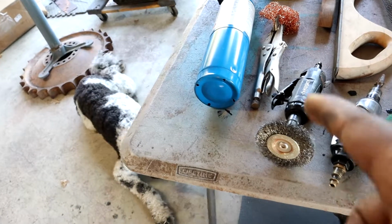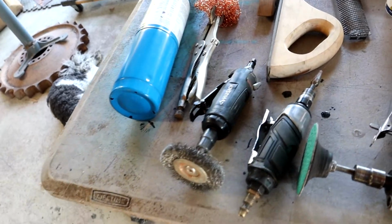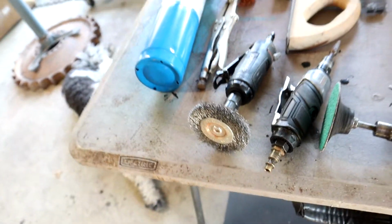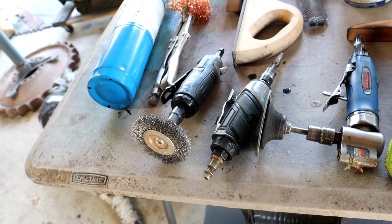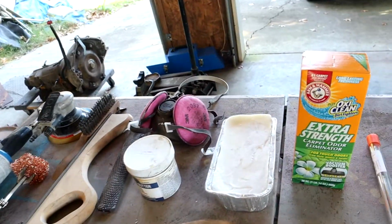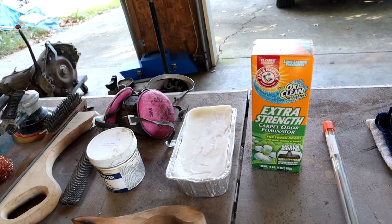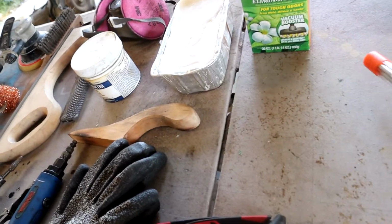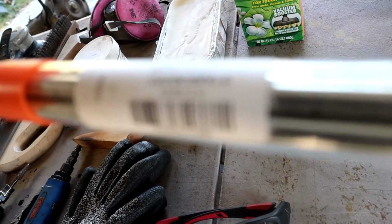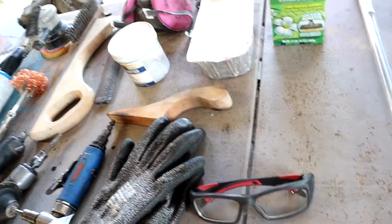These are some tools that you use to get it very slick and shiny, like a wire brush and a wire wheel to get into the edges and corners. You also have your 36 grit on your grinder. And I should explain the baking soda. That's going to be after we clean the surface, so we can neutralize the acid from the lead-free solder. And of course, I've got my lead sticks here, which I got from EASTWOOD. I'm not sure if we'll be able to get that in focus, but I will have all this down in the description below.